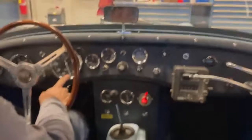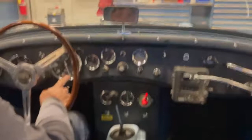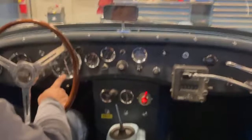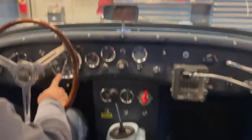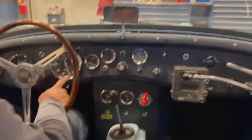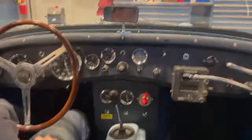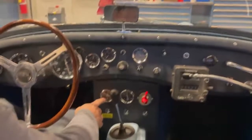You can see that the chronographic tach works a little bit different than a regular tach — it's not smooth, it jumps around quite a bit, and then that telltale stays there for a second at the maximum RPM that you reach. So you can see it's staying at 2000 there, so it looks like we're idling at about 1050 to 1100. Right now down here on the boost gauge it says we have five PSI of vacuum.